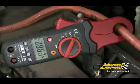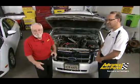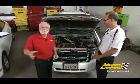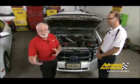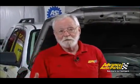That's actually fantastic — we've got about 2 amps or so here. That's kind of normal, somewhere between 1.5 and 4 amps. The point is, we have solved our diagnostic challenge. This tool really works, and we now have a way to safely check high voltage currents on a hybrid before we condemn a very expensive component. Now that we've got this vehicle diagnosed, we can shut it off and begin our repair procedure.